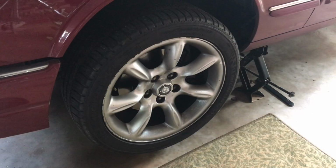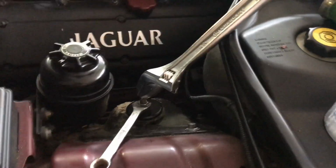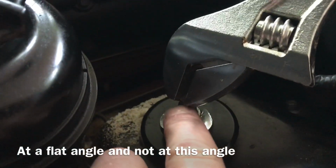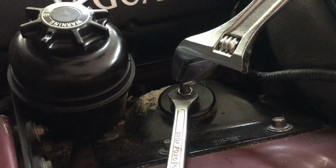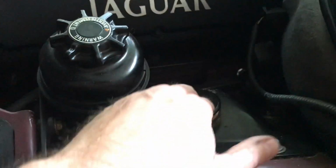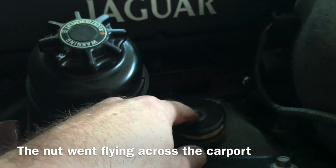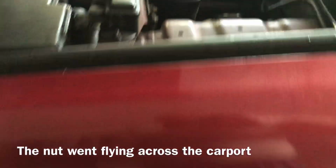So let's go ahead and remove the tire. There you go. It's best to get two people to do this. Somebody hold the crescent wrench steady, right there on the nipple, and turn this counterclockwise. It should come off, hopefully. All right, so that's done. When you're screwing this off, be sure to protect your eyes, because this can bounce back. It went down and it did pop. It's still under pressure, even though the tire and everything's off the ground.